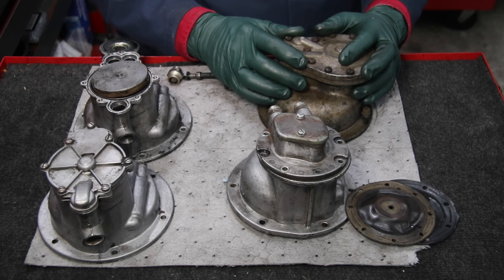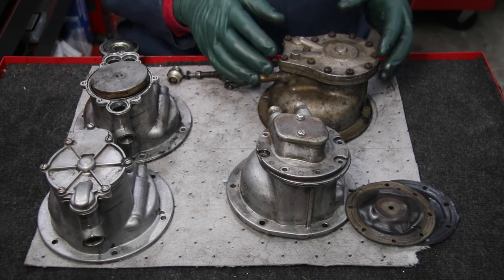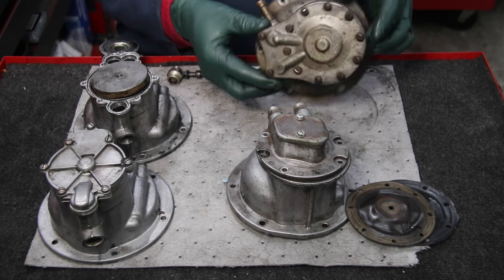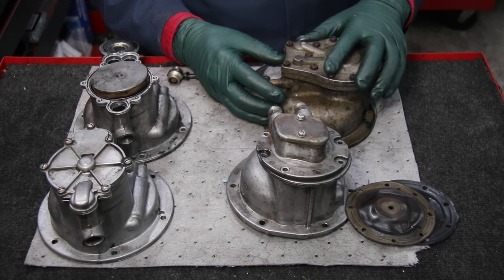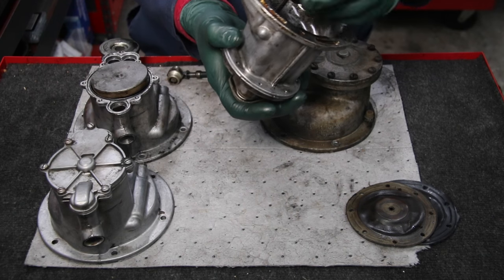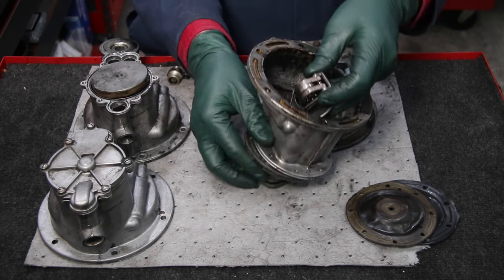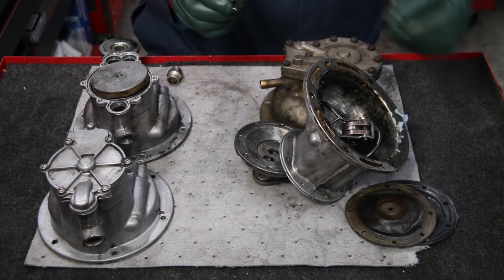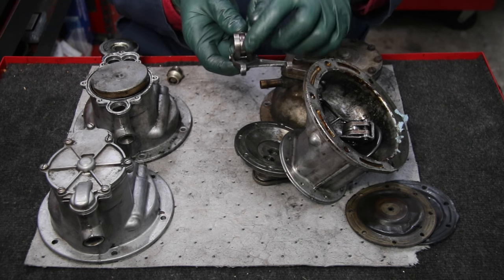You don't know if it's about ready to go bad or fail, even though the seller is saying it worked fine when removed from the car. So I'm going to tackle removing the cover on this old one here and see if the diaphragm is okay. One of the things you really have to be careful of — and I personally have been burned quite a few times buying used ones — is this bearing right here. This is the bearing that rides on the cam at the front of the timing device on the diesel engine, and this provides the pumping action.